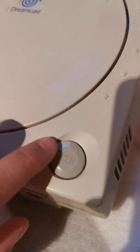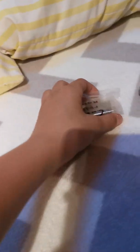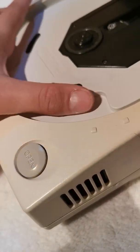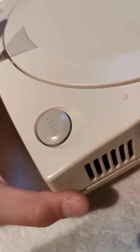So anyway, let's first start. We're gonna click the open button and right here are all the screws, as you can see. Firstly what I actually want to do is move the screws just in case, and then we can go and carefully slide off. Actually just to get a good grip let's close up the disk drive, and now after we've got that removed we can easily slide off the top cover - just got to do it very gently.